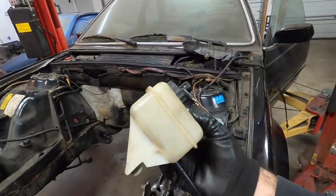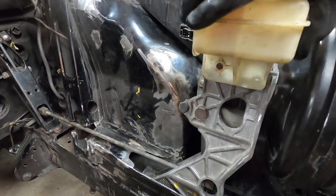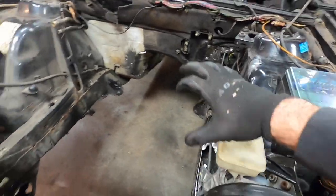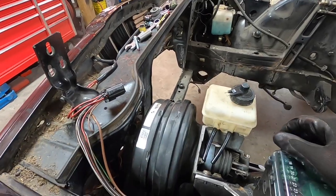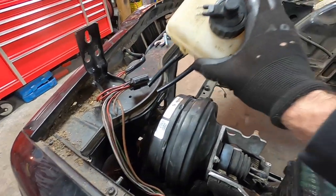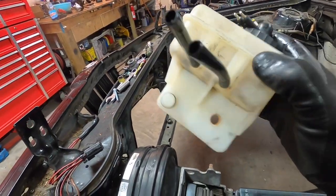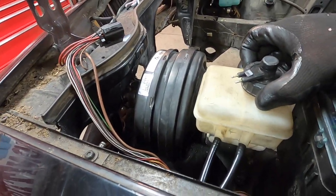This is the brake master cylinder for the E34 540i, and typically it installs just like this — it sits right on this thing. Unfortunately, when we put the engine back in, the power steering pump is going to be residing right in this location, so that's gonna have a direct interference. What's easier to remove or relocate — the power steering pump or the brake master cylinder? Since this is already remote and has two nylon quarter-inch lines that go directly from it to the master cylinder, the reservoir is actually a lot easier to move. Moving it over to probably something like on this other side is probably the easiest, most pragmatic thing to do.